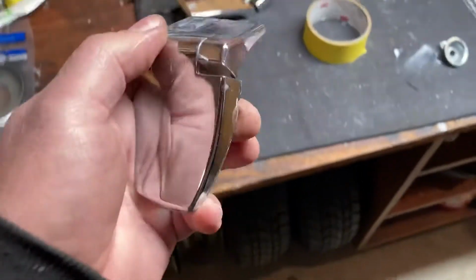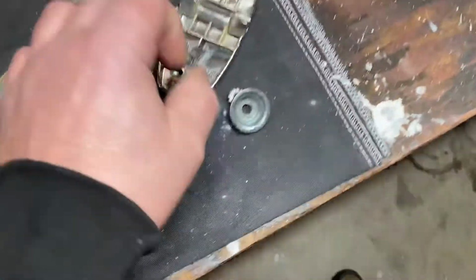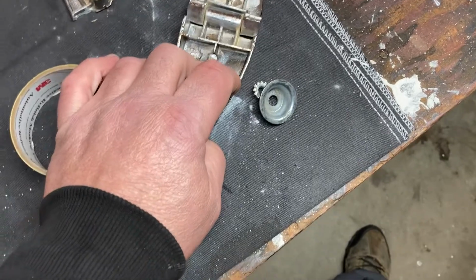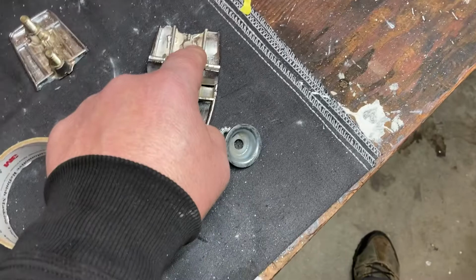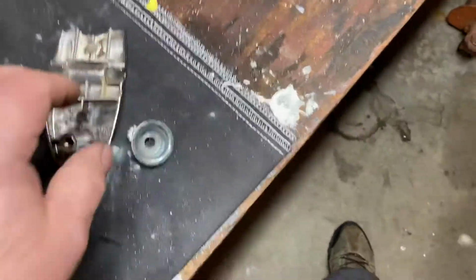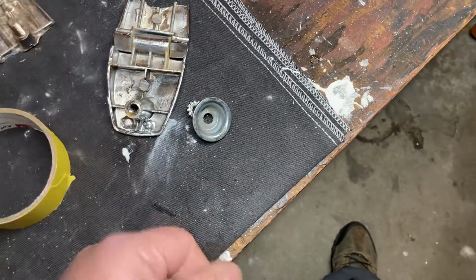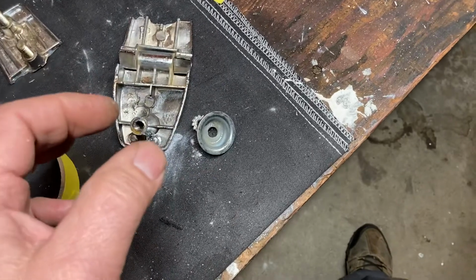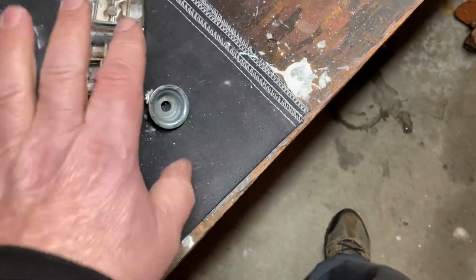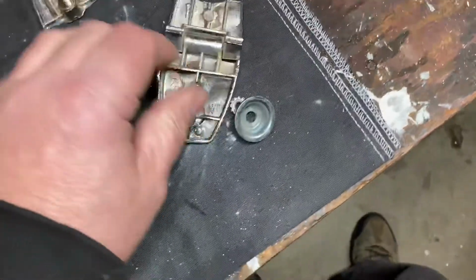Well, I got this sealed now. That's right. It sits like this on the car. And they have the gas spring hatch pistons, and the way they angle them, it puts a big load on these. What happened was the hatch barely stayed up, so I replaced one piston with something from a Toyota. And it worked absolutely mint. It was perfect. I couldn't do both of them because I couldn't close the hatch. And that didn't help the flex situation. But I still have the two original AMC ones that'll barely hold it up.